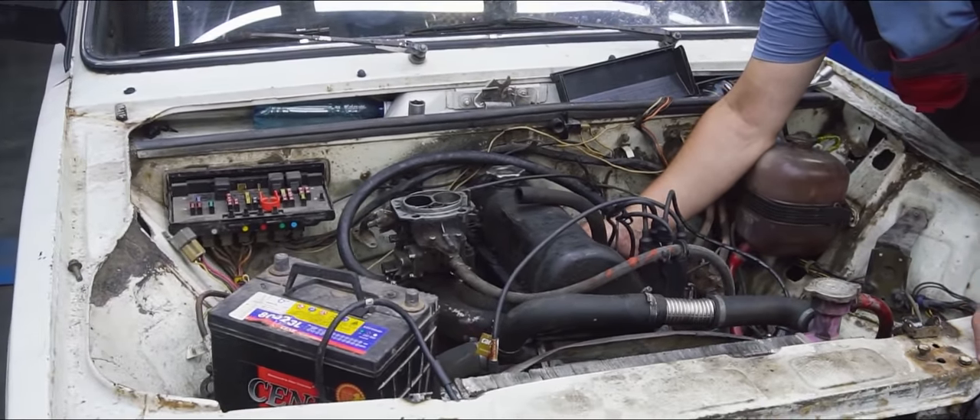With the head removed, let's look inside the cylinder. The piston's missing — I don't see any pieces of it. I'd say all of that most definitely found its way inside the sump, where it's currently residing. The cylinder wall is broken — there's a gaping hole in there. From the looks of it, while the engine was rotating and there were still some bits of piston left sticking to the rod, the cylinder was filled with coolant. Look how clean this became — we removed the head and it looked suspiciously clean. Looks like the coolant gave it a quick rinse.